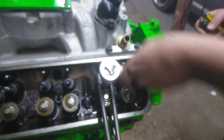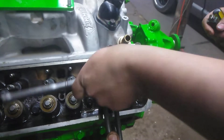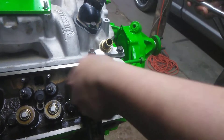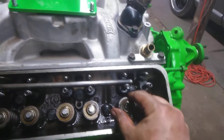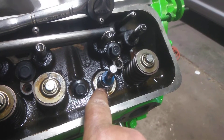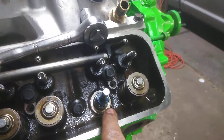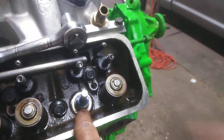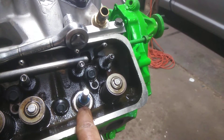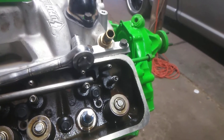Get a ratchet and take that poly lock back off. Grab that spring and pull the dampener out of it. What's happening is that dampener is hitting where they cut these valve guides back. The valve guide and that dampener are the same size. So when your rocker pushes that spring down, it completely compresses that dampener before you make a full rotation — before it goes all the way down and back up. So what it's doing is bending the pushrods before it comes back up.